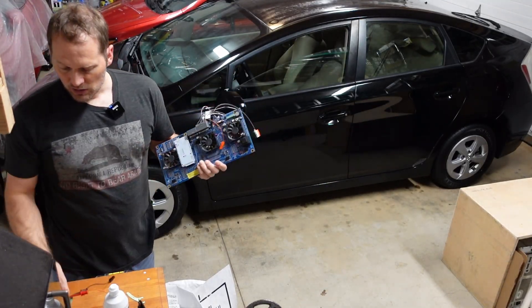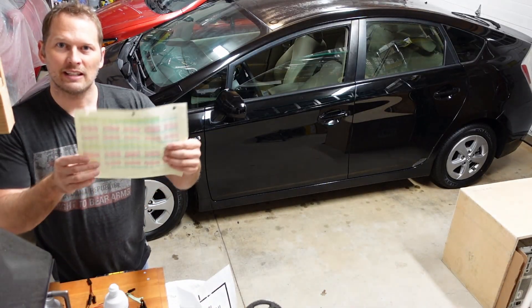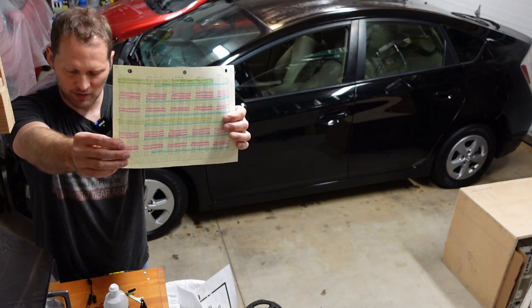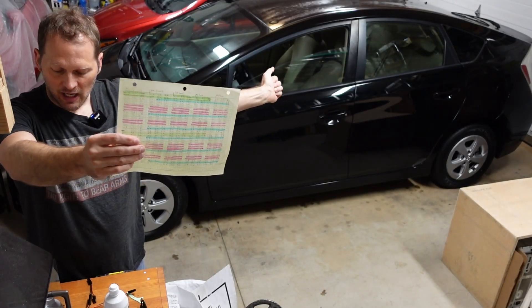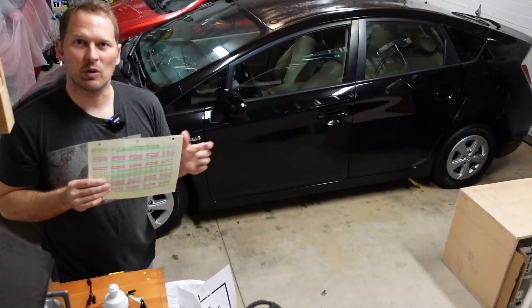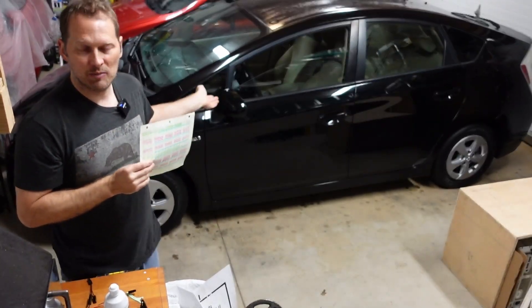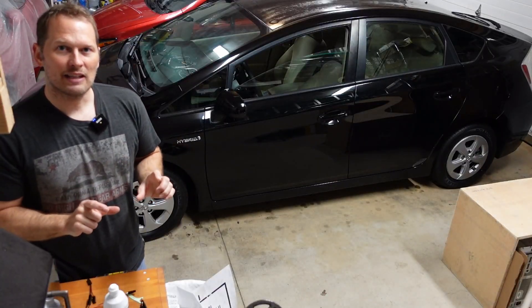This will give us supervisory control, allowing us to safely add lithium to the nickel metal hydride Toyota Priuses. We need to turn chicken-scratch data gathered by hand from the differential RS-485 serial bus on this Gen 3 into code that will work with the car without upsetting the OEM computer.